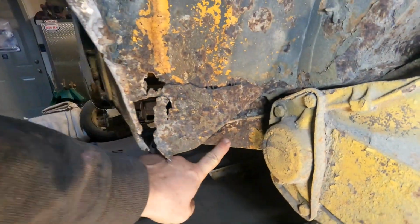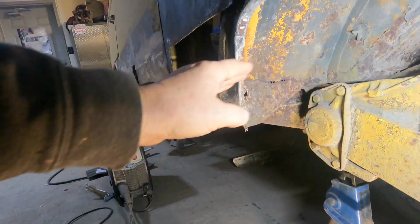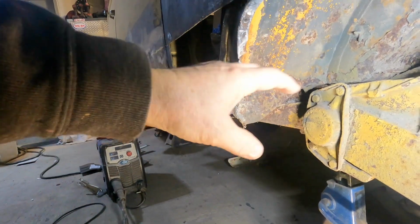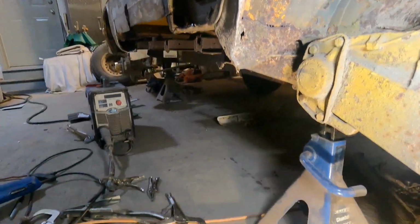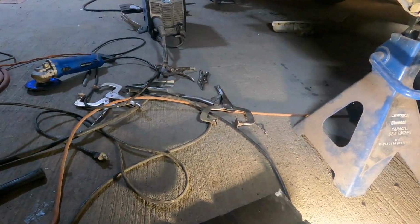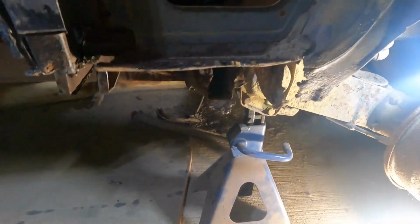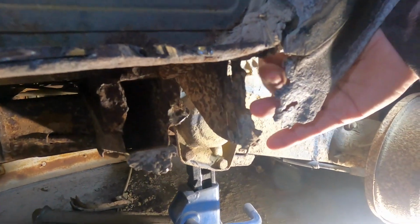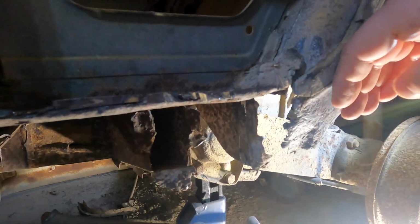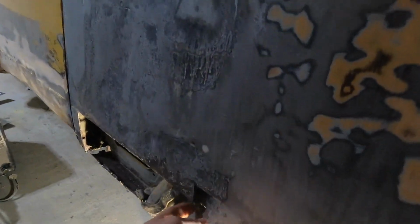We're going to remove this outrigger that's back here still, just the one left in there, get that cleaned up. Once that's all opened up and exposed, clean everything. We're going to do some rust conversion. We're going to get the new outrigger fit in place. We're going to get this new panel down here, fit up there in place, weld it in. Once that's welded in, that's going to allow me to finish this whole area here. You can kind of see that's going to be the piece will come down here. We'll be able to close and put some new metal down in this corner to get that closed up. That's going to finish off the rear wheel arch.